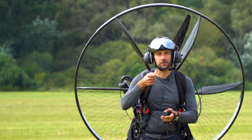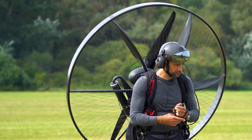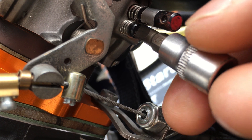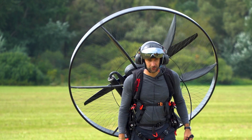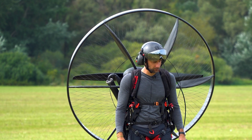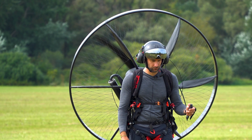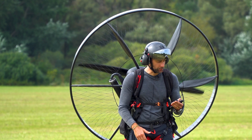Final adjustment: one step backwards. That means open the low needle by one step, and we should be right then. Let's see if it is. Sounds pretty good to me. The reaction to quick throttle was okay — now let me try slowly.